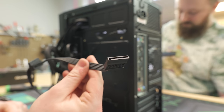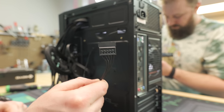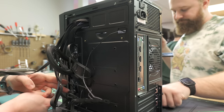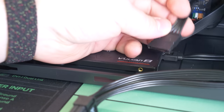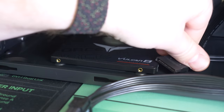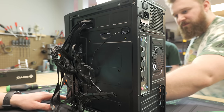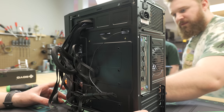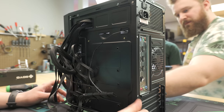Now we're going to power the SSD with the SATA power connector — kind of like the modern Molex. We'll feed that through and plug it in. With this case, budget cases come with sacrifices — it's not the prettiest. We're good to go there. At this point we can work on the graphics card installation. We already got the PCIe cable run through, which makes it a little easier.